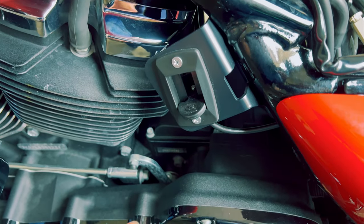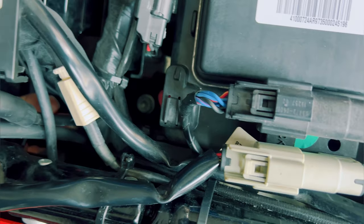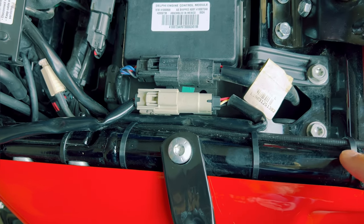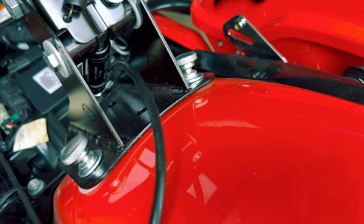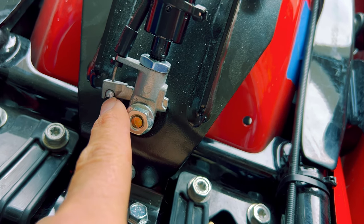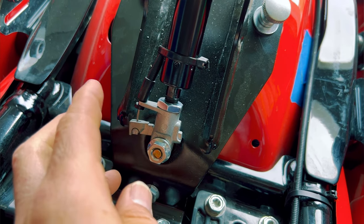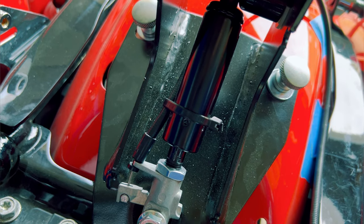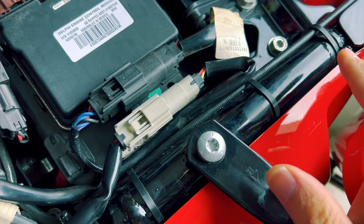Looking at the switch on the side, you've got your cable running out of the bottom. It tucks in, comes up right here, and you run it right along the frame — down, curve it around, right next to the cylinder — and it clips right in place, kind of like an old school bicycle, into a little groove that it falls into. To keep this in place, use a little zip tie on the cylinder. The kit calls it done right there, along with adding a zip tie or two to the frame to keep it nice and tight.